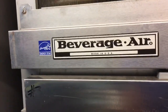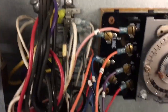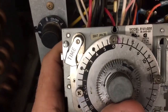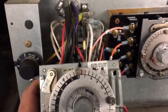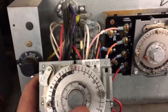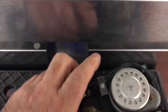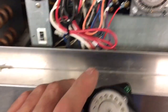So you want to change out a defrost time clock whenever you see one that has a date on it — this one is 2007. If you ever see a clock that's older than 10 years, just change it out. You're doing the customer a favor and yourself a favor. They're no good after 10 years; the motors quit or intermittently work. If you want to do a good PM, this one lasted 11 years.